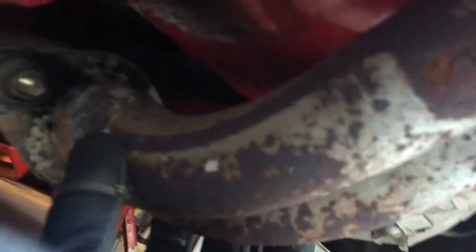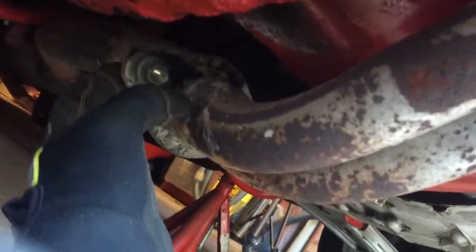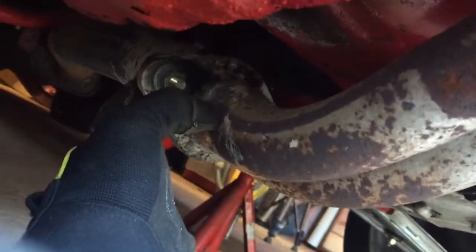I've taken the main brace off here. This is the joint I put in where I joined the four-branch manifold to the downpipe — it's still leaking from here. I'm thinking I'm going to cut that joint out, maybe put a sleeve over the top, weld one side and clamp the other side so I can still remove it if I have to. These downpipes are about 400 quid so I don't really want to buy a new one if I can make this one fit.